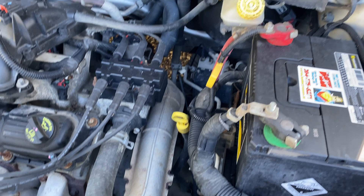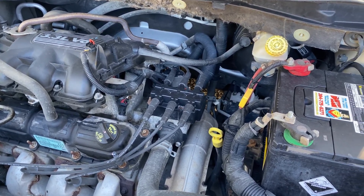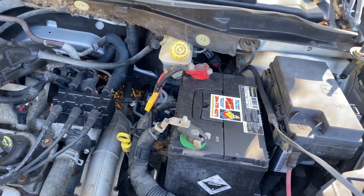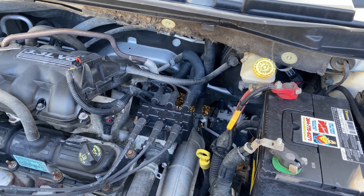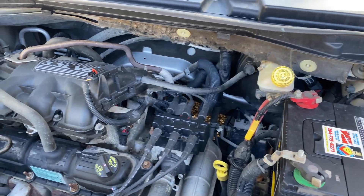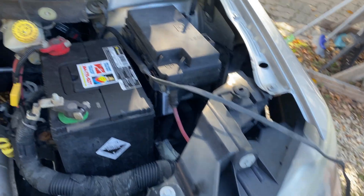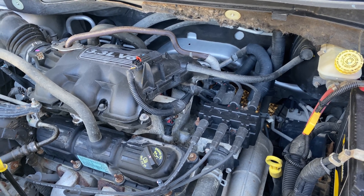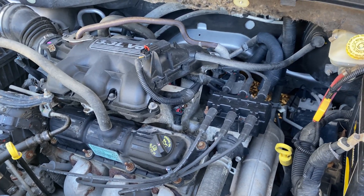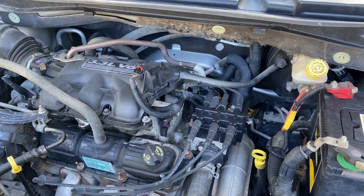You can't really see it here. There's usually a frost plug — what they call a frost plug on a vehicle — and you pop that out and put in this heater. I'll have a picture of one on my thumbnail so you can see what it looks like. You plug these in in the winter and it actually heats the antifreeze or coolant in the engine block to help it start when it's really cold outside. Let's go see what we're going to need for this.